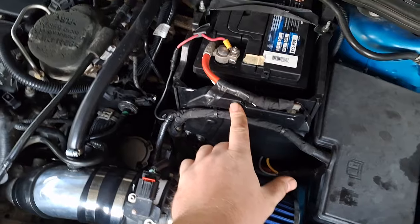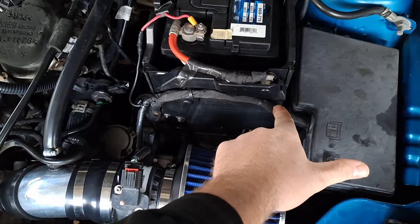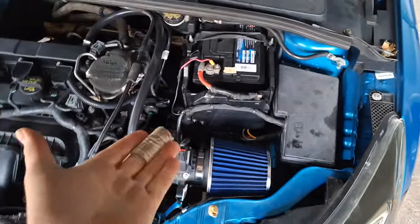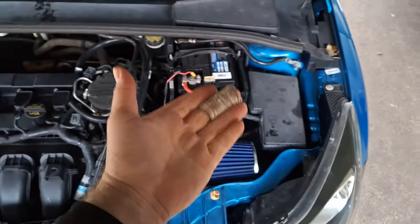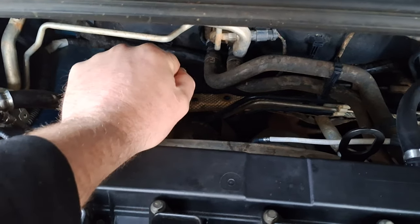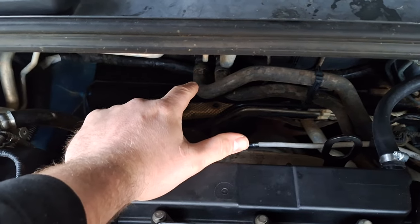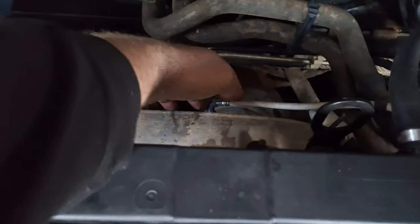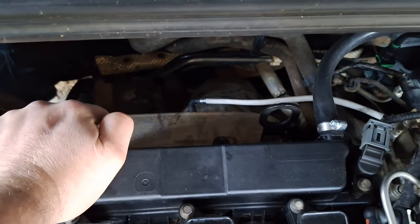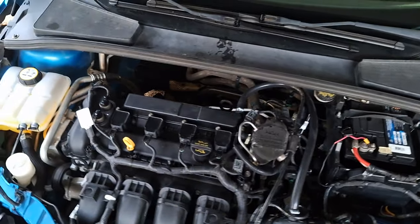Inside this battery box, pop the wiring retainers off and pop the little panel back — you'll see some fuses in there. Replace the 50-amp fuse all the way to the right. Those develop cracks inside and cause high resistance inside the fuse, leading to various electrical issues. That can be fixed for five bucks. The upper strut mounts can get noisy on these sometimes. Also, the O-rings inside the heater hoses here on the heater core can wear out and cause coolant to drip and cause the engine to overheat — replace those O-rings; I have the part number in my video. The upstream oxygen sensor can occasionally fail and get lazy, causing engine performance issues. I'd recommend OEM for that. You will likely get a P0420 on this car eventually, but I usually put an O2 sensor spacer on the rear O2 and that turns the light off.